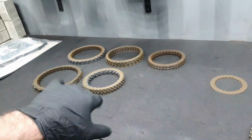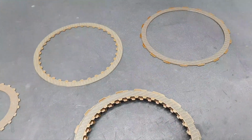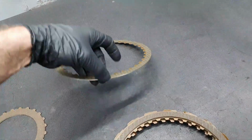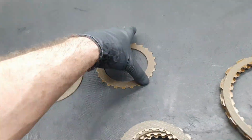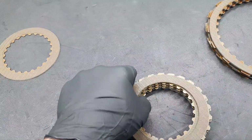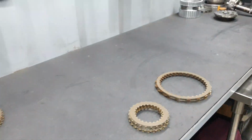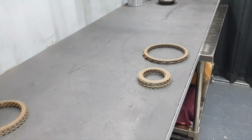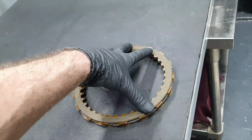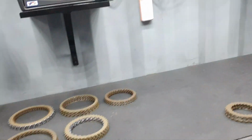Now I'm preparing it like that, then I'm putting it inside the bucket with the transmission fluid to get soaked overnight, or for an hour at least. In this case, it's going to stay overnight, sometimes only for an hour. Then forget about the clutches. I already know that. It's not something new, unfortunately, and it's never going to stop, it's never going to finish. I know that even the next time I order clutches, it's going to be missing one set again from this side and one from this side. I'm sure about it, not maybe, it's 110% sure.